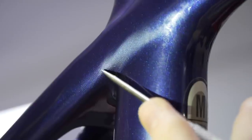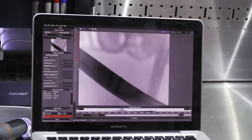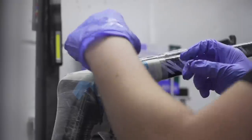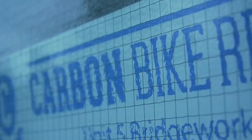That is a bit of a tricky one. Some of the easiest ways to test a carbon frame is to find that slightly damaged area and press it with your fingers — you'll be able to feel if the frame has more give there compared to undamaged areas. You can also tap the damaged area and often hear a slightly different or dull sound compared to other parts of the frame. The only surefire way to confirm your frame is safe to ride is to have it X-rayed by a specialist carbon frame repair shop, such as the one we visited a few months ago. They can give you a definitive answer and complete peace of mind.